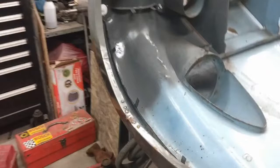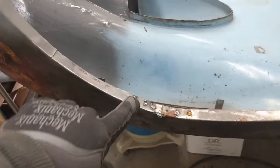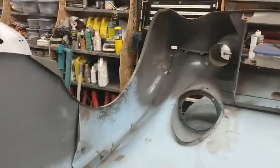I did start some work on the bonnet quite a long time ago, but it was before I knew about using copper to back it up, and at the time my welder was out of gas. So I'll have to reconstruct or repair this whole area. There's a split in the edge that can get welded up, another spot on the other lip of the fender to be repaired, and a piece across the front that needs straightening. Other than that and a few small dings, the bonnet is in really good shape.